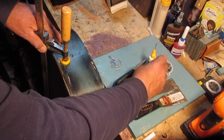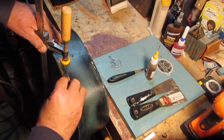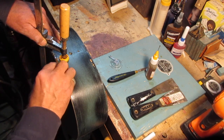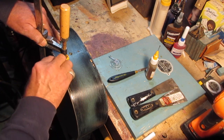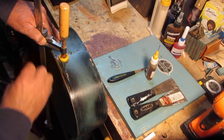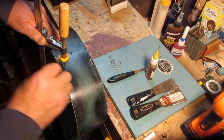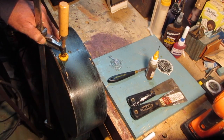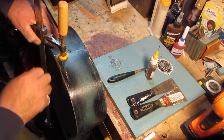what ends up happening is I take my wet suction cup. Remember, I start back here and I just push down, and it will push that glue right down into there. Remember, you want to start back here and push. If you push down and then pop it up, the same suction that pushes the glue in will cause the glue to pop back out. See, just like that. Boom. And then we're going to crank that down.